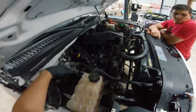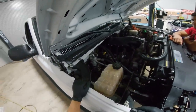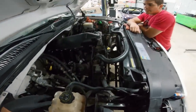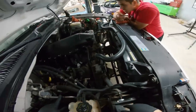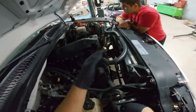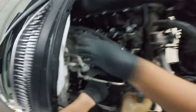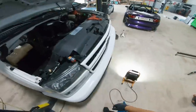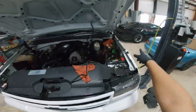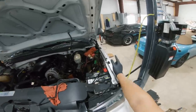This is not going to be much of a street truck — this is literally going to be a race truck in every serious sense. We're taking out all the AC system, the power steering, and putting in a manual rack. We're deleting the entire factory harness and replacing it with the Holley system. This truck is going to be quite the character when it's done — pretty scary. The goal I set a long time ago was to make it faster than the Mustang, which just ran a 9.71 in the quarter mile.